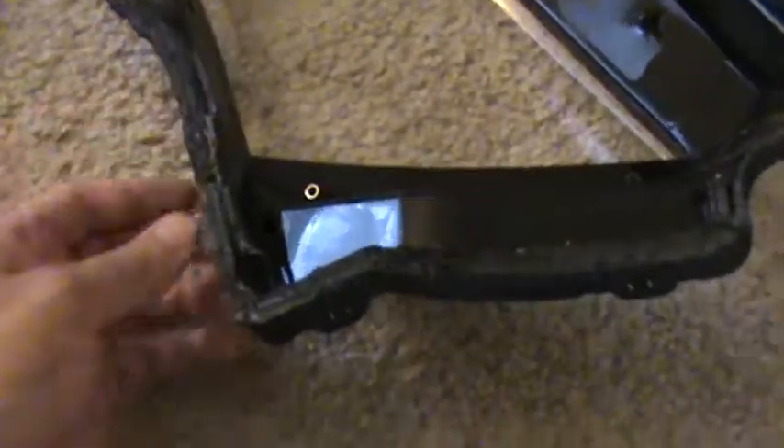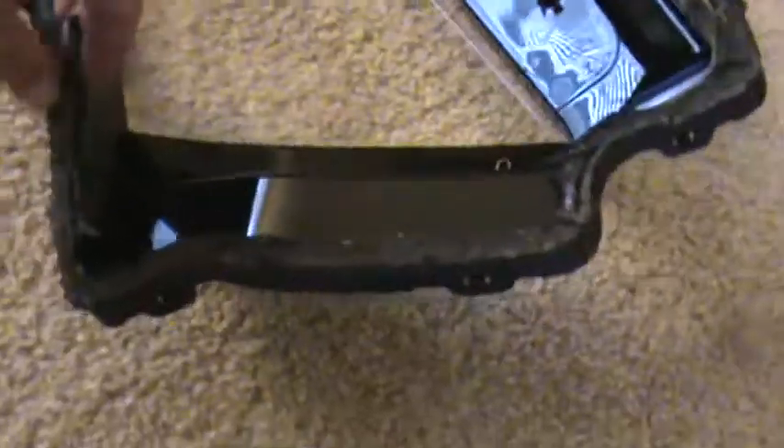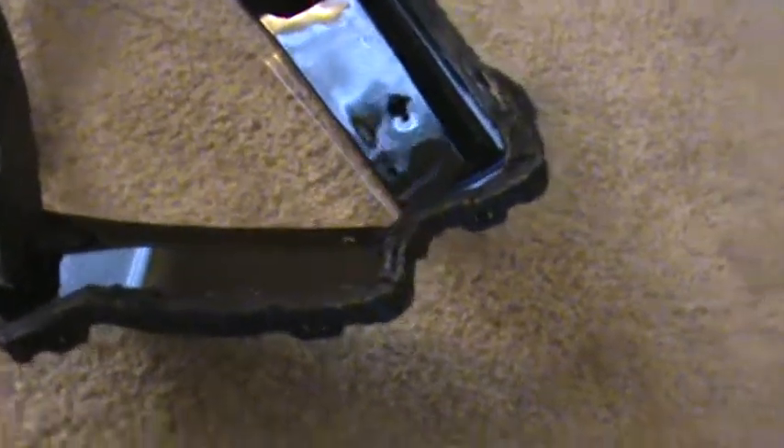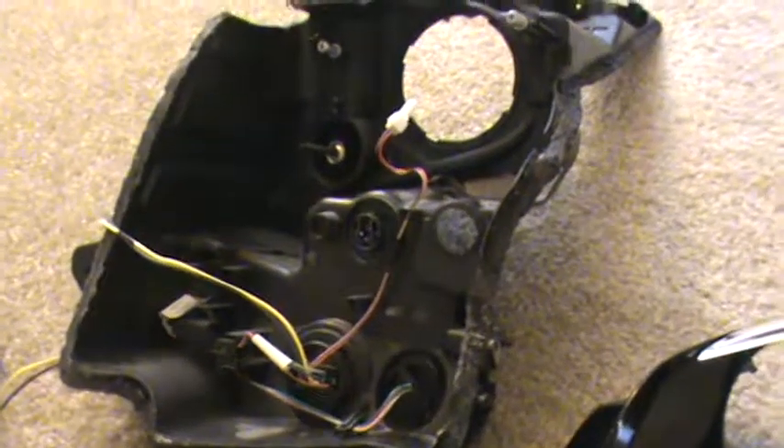You can see here it's a pretty thick border of permaseal — I'd say a solid half an inch thick — and it goes all the way around. Fortunately, I used my hot knife and then the Dremel a bit, so there isn't a whole lot of warped plastic. It's just pretty much a smooth edge that I'll probably leave pretty rough so I have a surface for the butyl glue to attach to. It's going to run all the way around there. I got two rolls of this stuff, better to have more than not enough in the middle of a project.